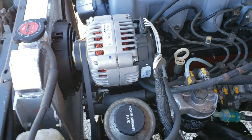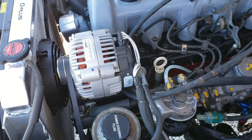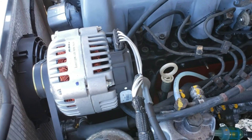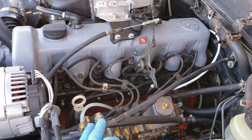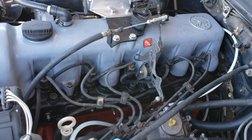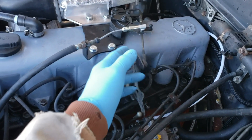The fourth wire is a tachometer signal output, and that gets plugged into a Dakota Digital device that translates that signal into a usable output for the Toyota tach, so our factory tachometer will work. This has the longer V6 throttle cable — you can actually get a replacement from ATP that's shorter and fits a bit nicer — but it works great; the travel of the pedal matches the travel of this mechanism perfectly.